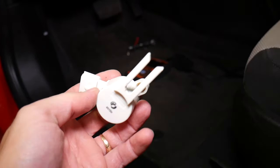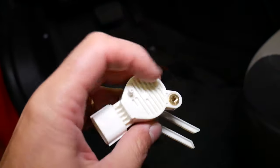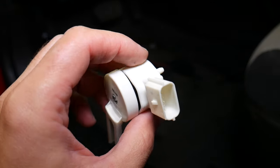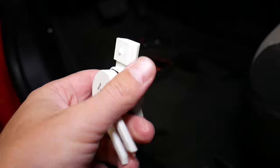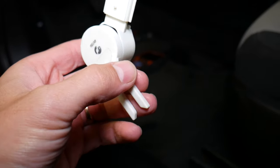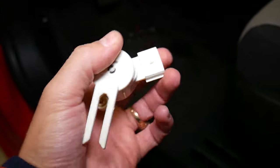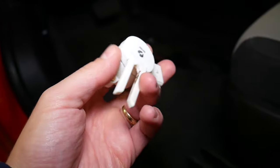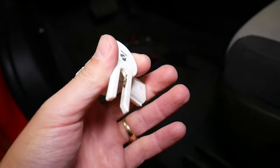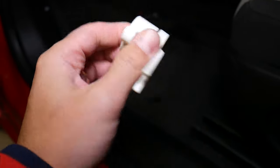This is it guys — this is the brake light switch; that's what it looks like. You can see that's where the bolt goes, and there is a special place where you mount that thing. The brake pedal attaches right here. Sometimes these things will break, sometimes the switch will malfunction, and you may not even get a code if just one of those things breaks — but your lights will not work. In some cases you may need to calibrate it; we have a video on the channel explaining how to do that, though not all vehicles require it.